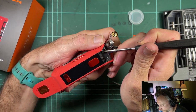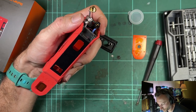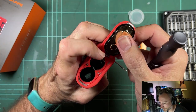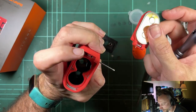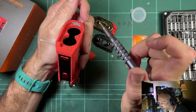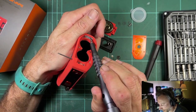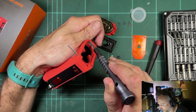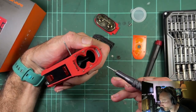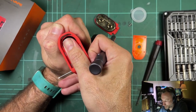Now getting the board out — there are two little hidden screws and they look like T4. I've seen a few people complaining about battery door issues; the little metal tag starts to wear and doesn't hold in properly. When you slide the release back it pulls that little metal tag back, and it sits in a slot in the zinc alloy casting, which isn't the strongest. A good tip is to push the door in nice and firm with the release pulled back, rather than forcing the door back without pulling it.